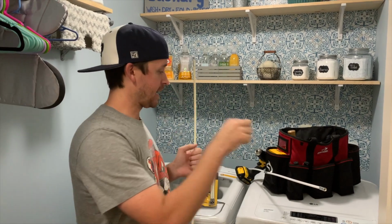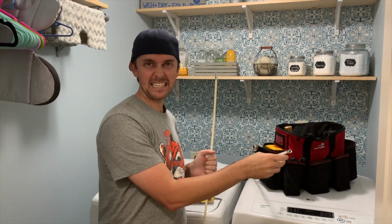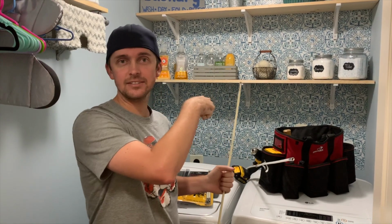Sometimes you're trying to make a video and you're thinking everything's going to work out great, and it doesn't. This is one of those cases. So we got this little duct cleaner that was about 8 feet in length, and I shoved it down into the laundry duct, and we cleaned out a whole bunch of lint. But it apparently didn't do all the job, because my wife started to do some laundry, and as she was drying, she got that code again.